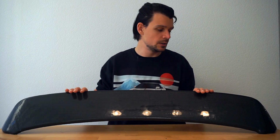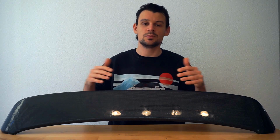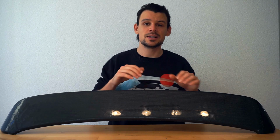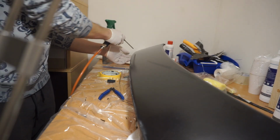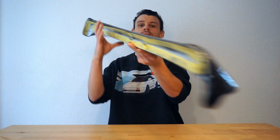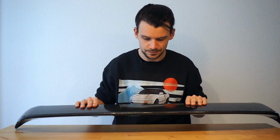And no endurance is not just taking your time for the layers or putting drying time between them. No, it is, for example, the cleaning. So when you sand it, you really need to clean, because when you have dust on it and you put another layer of resin on it, then the dust is inside. Now I should have a lot of fingerprints on it, but okay.